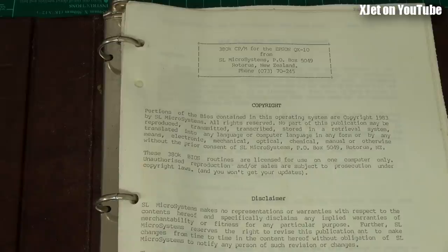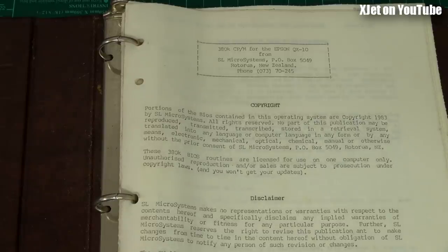So I sat down and rewrote the BIOS - the machine-dependent part of the Epson QX10 CP/M - and added cool features like background print spooling. Back then, computers didn't have multitasking operating systems. If you had a word processor and typed up a document and wanted to print it, you couldn't use your computer until the printing had finished. Every single character was sent to the printer one at a time. With my print spooler, you could say print and immediately the computer was free to do other things while printing in the background - fantastic, unheard of stuff back then.